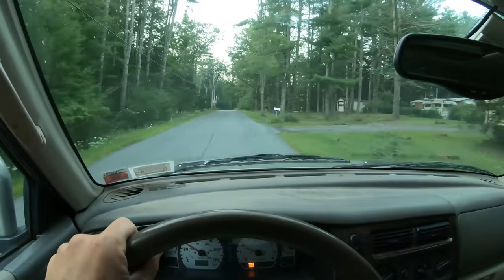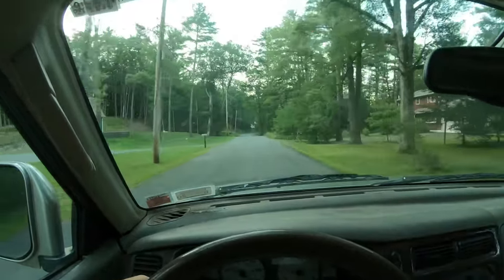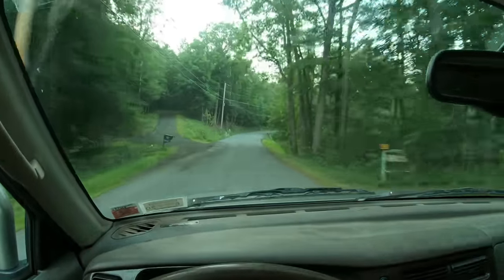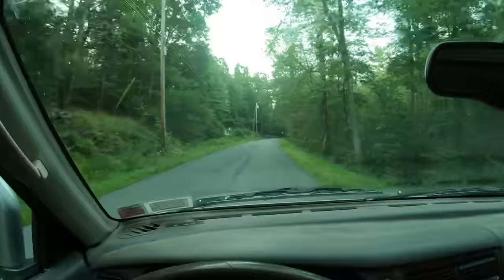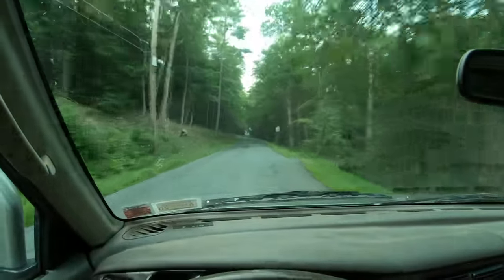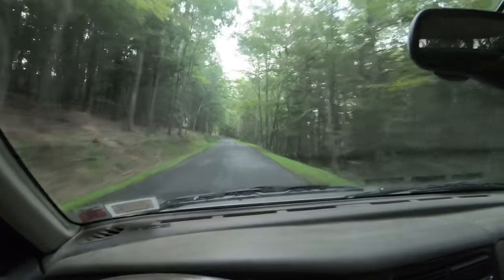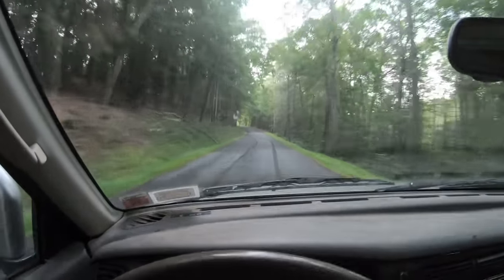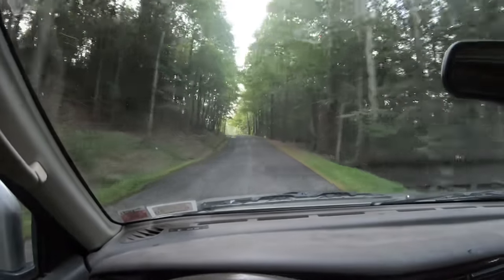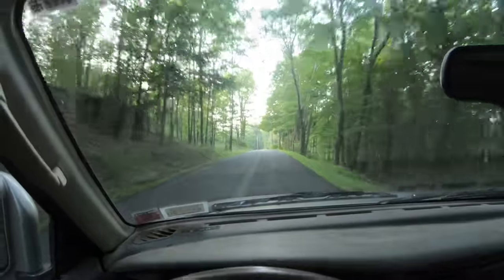All right, so I've actually been driving this car a while now since I fixed it, and that's definitely fixed. I'm glad I took the time to do that right and put those copper nickel lines on there, because they will never rust out. The steel lines seem to rust out in around 15 years or so, they start blowing out, the brake lines and everything. The copper ones just go forever. So really, the car wouldn't have even broken in the first place if it had just come from the factory with those copper nickel lines or stainless steel.